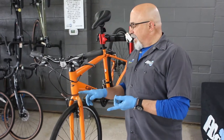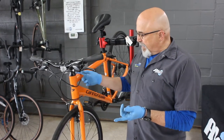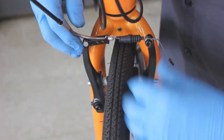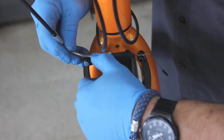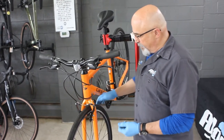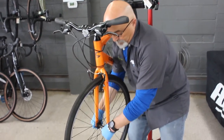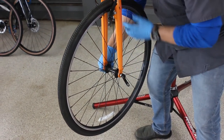There are a bunch of different kinds of brakes and different ways that wheels go on bikes. We can't show you all of them, but here's one other very common example. This is a so-called linear or V-brake, common on hybrids and earlier mountain bikes, and it disconnects like so. Squeeze it against the rim, release the noodle — this 90-degree bend piece — and the brake pops right open. Once you have the brake open, you open the quick release, and on the front wheel you've got to unwind it about six turns; the wheel will come right out.